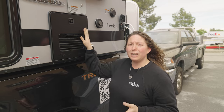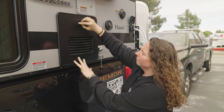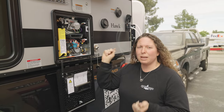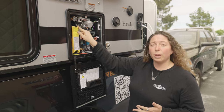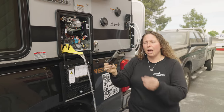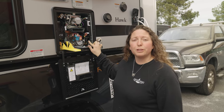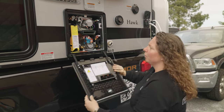Now we're going to winterize the Truma water heater. First, open up the access panel — make sure when you're lifting off the panel, you lift it up first and then bring it down, or you might break the little hinge tabs. Once inside, the first thing you want to do is release the pressure valve. Now, with the quick release, we're going to open up the easy drain for the water heater — water should start to flow out. You can remove this filter for storage and tuck it right in the cabinet. For storage, make sure your filter is out of the unit, then close the easy drain and replace the access panel.